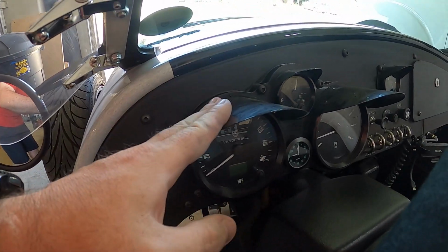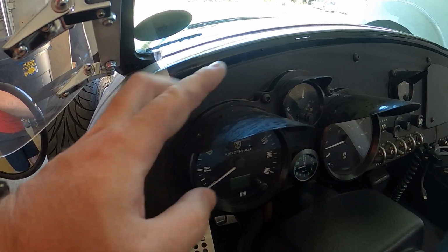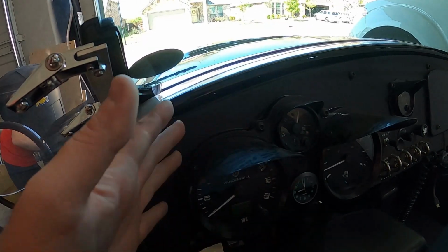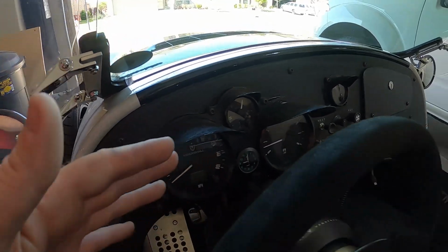There's somebody making a 3D printed one, or I guess it's molded now, that you can buy for it. I'm not sure how to get it. If I figure it out, I'll link it in the description below. But some way to cover these gauges at night so you don't get the glare on the windshield is almost a necessity. They make a dimmer kit, like a switch, that dims the lights a little bit for driving at night, which is better than nothing, I'm sure. I don't have that on this version. I think it's standard on some of them after a certain VIN number, but not on all of them. And even if you just dim it, it's not enough to get rid of the glare completely, so most people are putting little visors on the gauges.